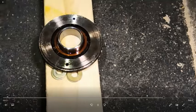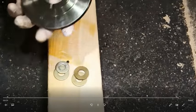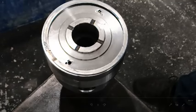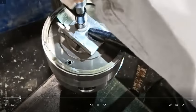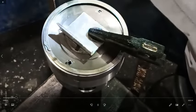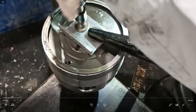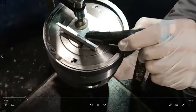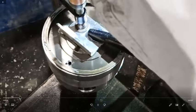I put the housing upside down on a 2x4 on the ground and tapped the bearing — it went straight into the wood, really easy to get out in about 3 seconds. Now when I installed the lid, I actually heard air come out and it went down effortlessly. This is the way to do it. In the previous video I said tapping out the bearings was unnecessary — I recommend it now. It just drops right in, air comes out the hole, and it goes together so well you don't even need clamps.